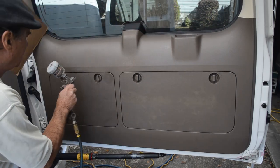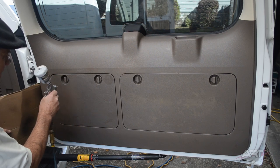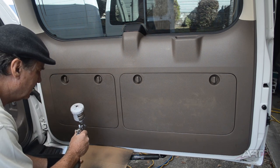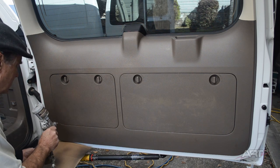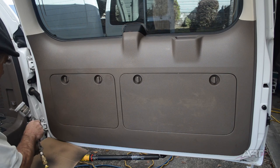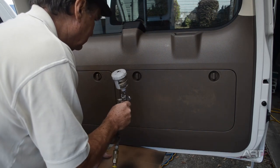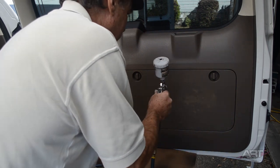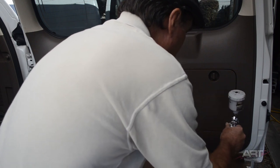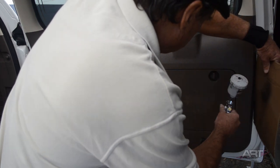When the damage is this extensive in a wide flat panel, I'm sure you can see the advisability of texturing the entire panel to get everything to blend in. And the other problem that folks seem to have is having shiny areas of the repairs. And so we might just highlight again the need for extra flattener in your paint. That's going to work wonders for the coating. If you still see some shiny areas, go back and add some flattener back into your paint and strain it again.